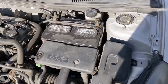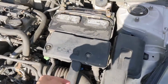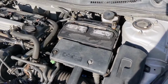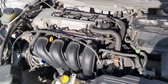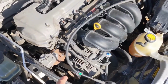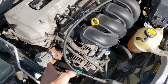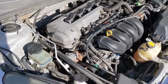You need a 2ZZ ECU. The ECU is stored in here, I believe, and if you have automatic or manual, you want to account for that. And on the older models, the red line is higher and lift kicks in at a different RPM, so just be aware of how you want to configure that. And then for the engine swap itself, you'll need a few new pulleys. I don't remember which ones specifically. The alternator has a couple more bolts, brackets for like the engine mount. You need, I think it's the bigger downpipe, but it's really not too big of a job.